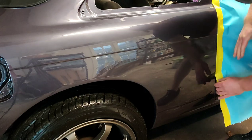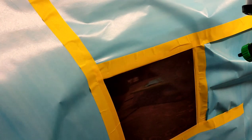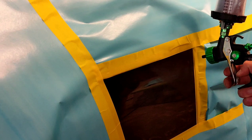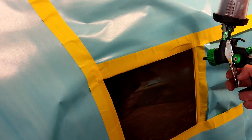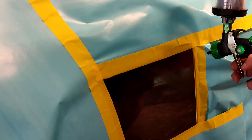Starting off, a lot of you guys are going to ask: how do you prep a blow-in style repair? As you guys can see, we have some 1,000 grit right where the burn-through was and then 2,000 grit on the outer edge. And as you guys can see, I'm just barely pulling back on the trigger, and that is really key to these blow-in style repairs.